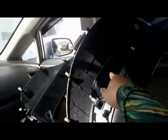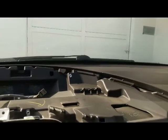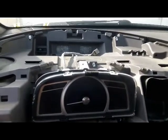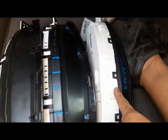Now I'm going to compare this unit to the two that I got and see if it's actually the same part before installing it. This is the one that just came out — the OEM that came with the car. This is the second one the seller sent me, and this is the 2007 model. As you can see, it's designed differently. These pockets — it's not interchangeable. Even though you can mount it in and the mounting bolts will align and the connector will reach, it will not work.